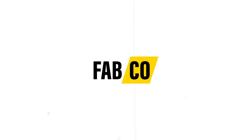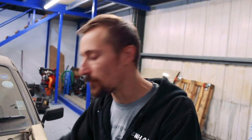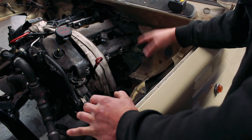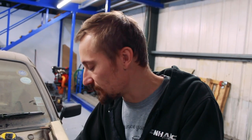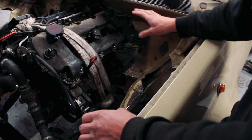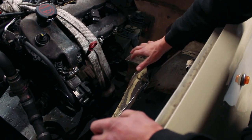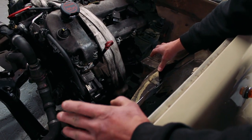In this episode we're going to look at cutting out the original chassis rails and fabricating some new ones, then tying them into the car body and remounting the subframe. I've cut out some more of the bulkhead so the engine is actually in - took the gearbox off, no sump off. The engine is in now. We don't have the strut tower for the front yet or any of the upper arm mounts - those will come at a later date. I've decided to get rid of these original chassis rails because I've already done the work figuring out where the subframe goes and at what height.